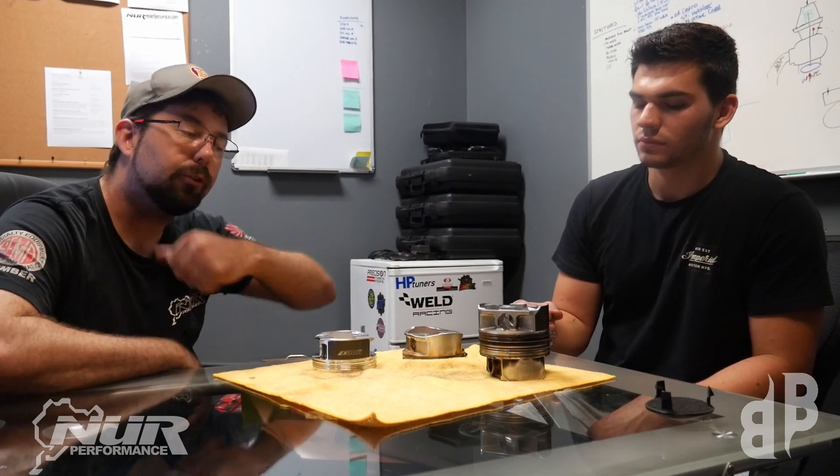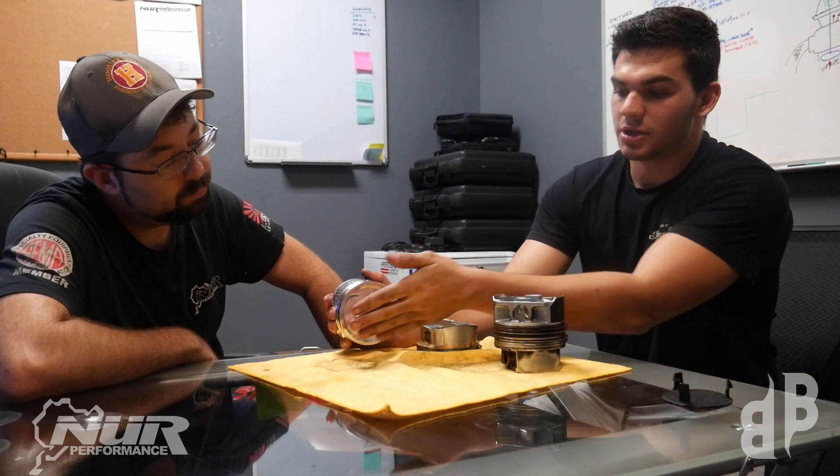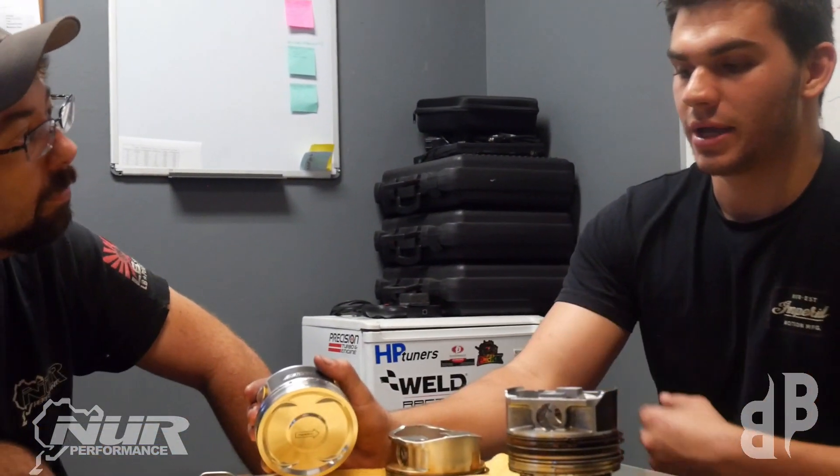What we need to do from this point is show the ring out that the car came with — we still have the ring off the number one piston out in the shop. In a few moments we'll compare them to see the difference between the old rings and the new rings, and you're going to be shocked. Basically we have two factors that play into ring land failure: it's the space from the top of the piston to when it reaches its first ring, and then the ring gap itself. The reason these failures occur frequently is because there's just too much heat in the cylinder. If you have a particular tuner that understands the dynamic of what's happening inside, you can tune around the flaw of the engine and safely make a lot of horsepower. But because the clearance is so tight and the system is not optimal from the factory, you're walking a fine line — a bad tank of gas could result in failure, and that's actually what happens on the street.